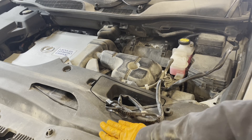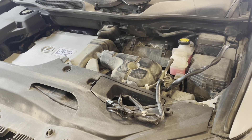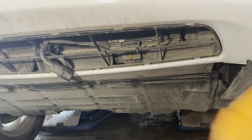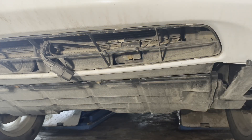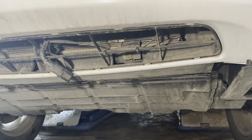On this particular model you can remove this cover and run the cord down inside the front bumper, so it comes out at the front for easier access. Secure the plug in a convenient place. Some people leave it dangling outside the hood, but it can sway in the wind and scratch the paint or headlight. Most importantly, don't forget to unplug it before you drive away, otherwise you might rip a few things off.